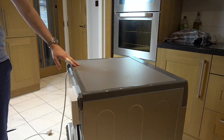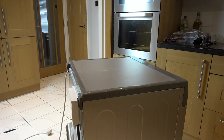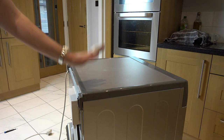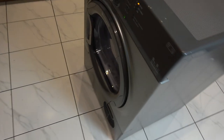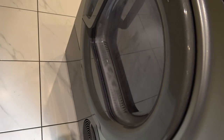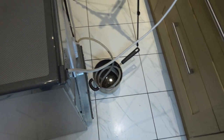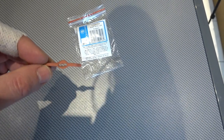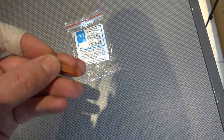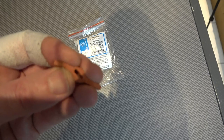That's it. I'm going to put some wet clothes in there now and see if it takes out any water, then put it in the garage and see how it operates over the next few weeks. The clothes are on now — you can see condensation on the door and it has gathered up some water. This is a condenser dryer, which is why it gathers water like that. For the sake of a few pounds and 20 minutes of my time, I think it was worth it. It could be a simple fix like that on your machine.